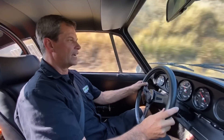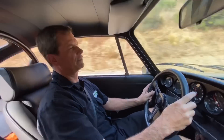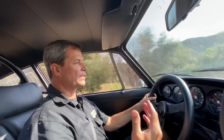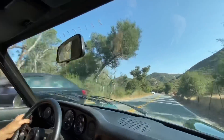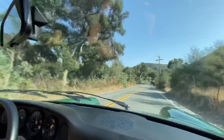Being a 1968, this is known as an SWB — Short Wheelbase Porsche. It's got a wheelbase that's a little bit shorter; in 1969 they went ahead and extended it a bit. But it makes this car a little more lively in the turn, so you've got to be careful, especially with all that torque back there — 400 kilowatts in a tiny 2,400-pound Porsche. At the end of the day, you end up with a car that's really fun to drive. If you've got a lot of time in a Tesla you'll know you can really feel those 5,000 pounds. It's so fun to have the same power and put it into a car about half the weight — you get something that's really lively, goes through the twisties, and it really drives the way it's supposed to drive. You don't have all that weight and body roll that you have in the Tesla, so it's just an absolute blast.